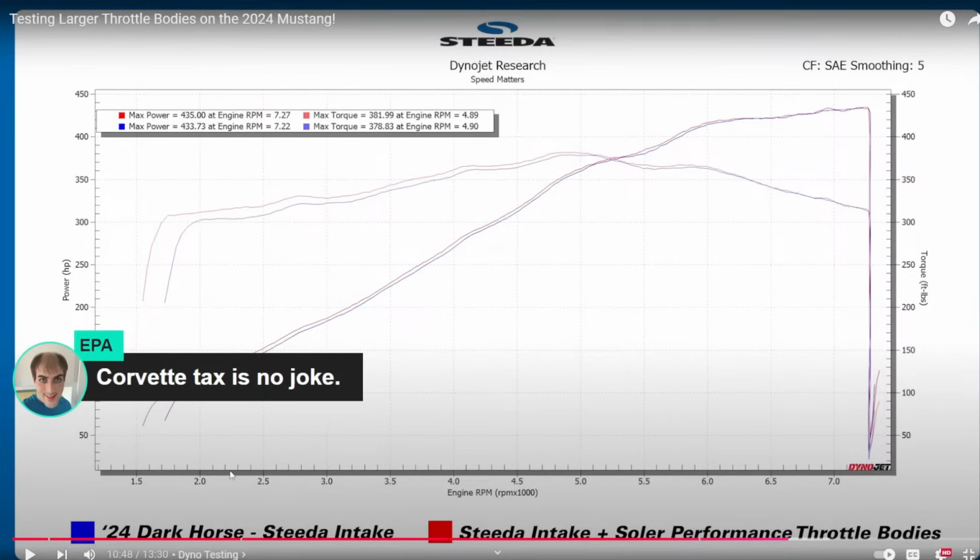And how do I know that I can't make this exact power with throttle mapping? See, airflow makes more power up top. Also, it's dependent on where they're putting the cams. This is very true because you don't have access to the tuning. You can't swing the cams in a favorable way to benefit airflow up top. But you would think after 5,000 RPMs, you would make more power with 2 bigger throttle bodies, right? Nope. You make torque and a little more power before 5,500 RPMs.